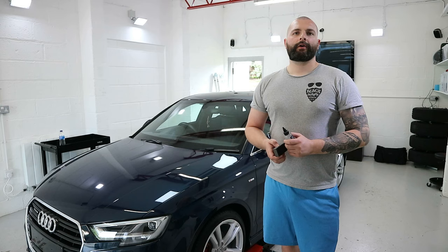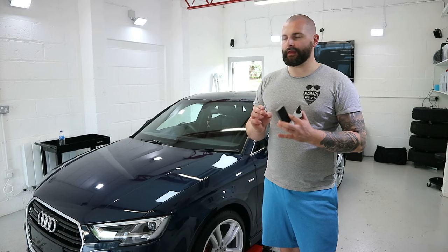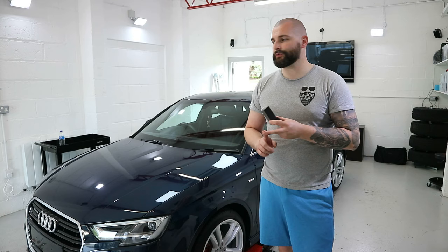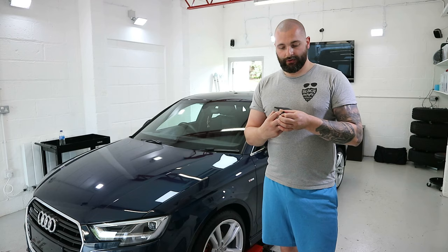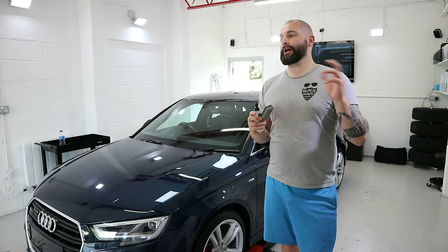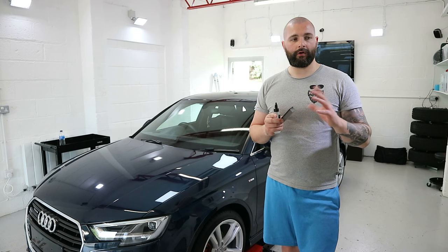That's the machine polishing phase been completed. The interior has been done, interior glass all done. So what I'm going to do is rain repel treat or glass sealant the exterior windows. So real simple, easy to do. Front gets two coats, the sides just basically get the one coat. 50 minutes cure time, buff off, and in between that curing time I will go and seal all the plastics in the engine bay.